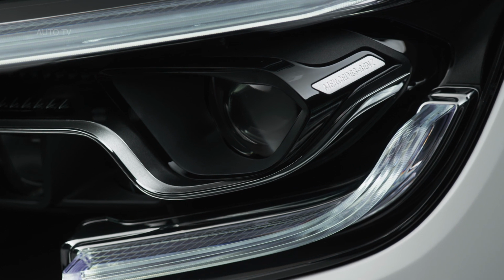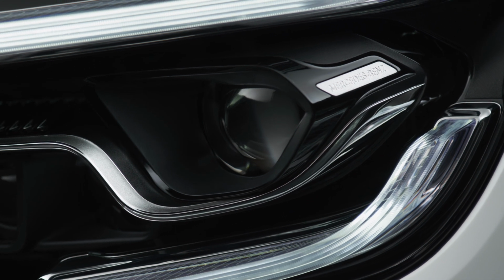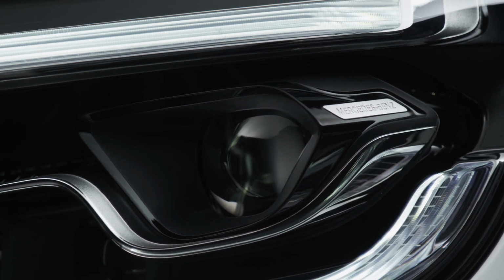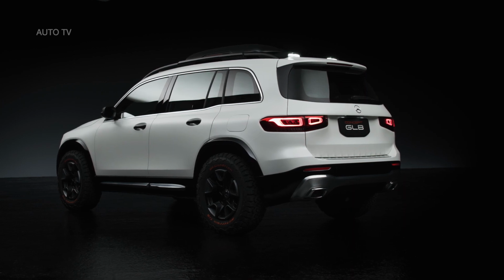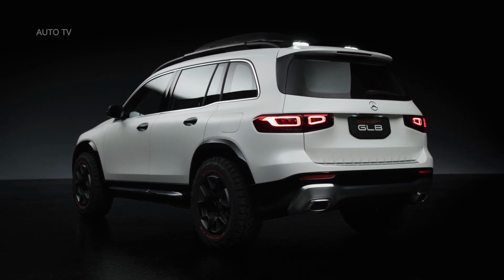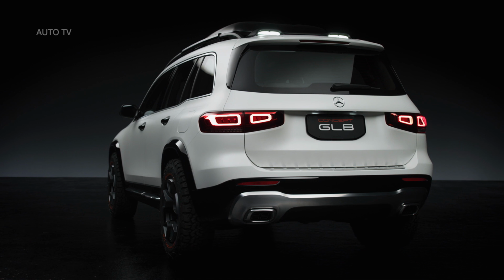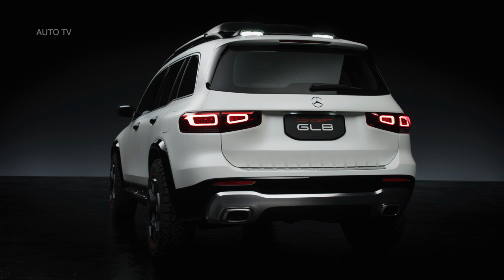4MATIC components include the power takeoff to the rear axle, which is integrated into the automated dual clutch transmission, and the rear axle differential with an integrated multi-plate clutch. This is electro-mechanically operated. Via a crown wheel and a ball ramp, an electric motor exerts an axial force on the clutch pack to open or close the plates. The rear axle differential compensates the different paths and rotational speeds of the rear wheels. The advantages of this control system are above all non-RPM-dependent operation across the entire actuation range, pilot control of the clutch while still stationary and higher efficiency thanks to the ball ramp concept.